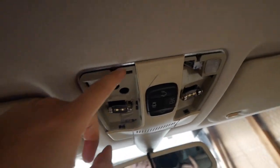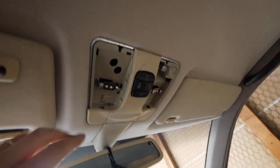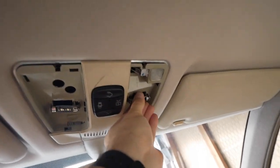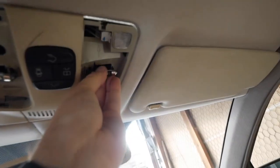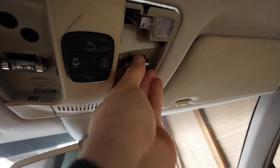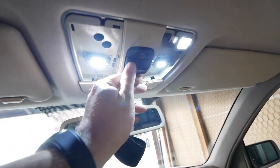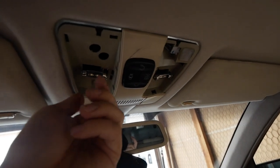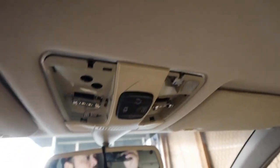It's very simple to take off — just pull on these two tabs and it comes right down. One curious issue I encountered with these dome light bulbs: squeeze the pins a little bit tighter because these are slightly smaller than stock, so make the pins a little tighter so they stay in. If these lights don't work when you press the button, just rotate the light 180 degrees — they're directional and that's how they work. First three lights are in, let's get to the rest.